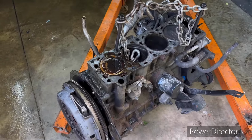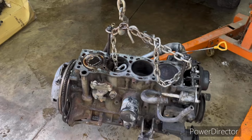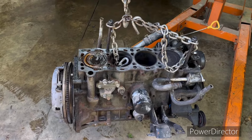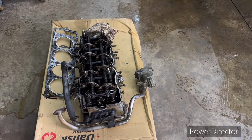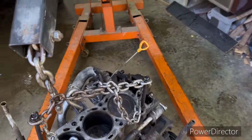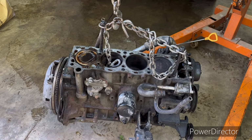I guess we're going to end video one in this series right there. I went ahead, like I said, and pulled the head off in the truck. It made it easier to get out. Those bolts don't matter. I'm going to be replacing them anyway. So I guess the next video, we're going to get it down there on an engine stand, start taking it apart. We know we're going to put new pistons and rings in it. We know we're going to have it punched out. We're going to get this thing stripped down and take it and have the head pressure tested, have the block checked, decked, and bored out 20 or 30, probably just whatever the guy needs to do to clean it up. We don't want to go too much. We're not trying to build a drag racer or nothing like that. We just want to get it to where it don't use oil and obviously figure out where the water is going. So anyway, stay tuned.